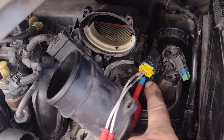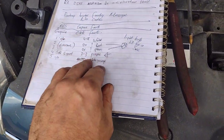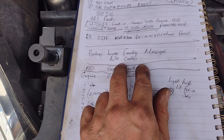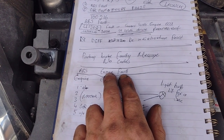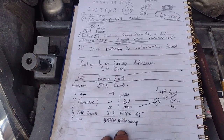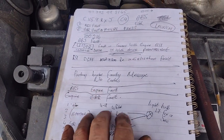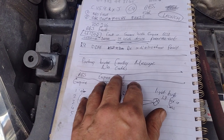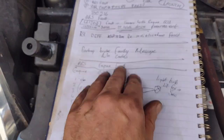What I want to do is give this one something about 1 volt or 1.1, somewhere around there - see if I can clear the fault code and then see if it will allow me to clear the ABS fault codes. I've got an electric parking brake and I'm getting a message for that on the dash, but there's no fault codes in the module. The ABS has an engine fault, and when you go into the engine it says it's got an EGR fault. So I think if we fix the engine fault, the ABS fault will be happy - and consequently the parking brake, because it's linked into the ABS for hill starts.